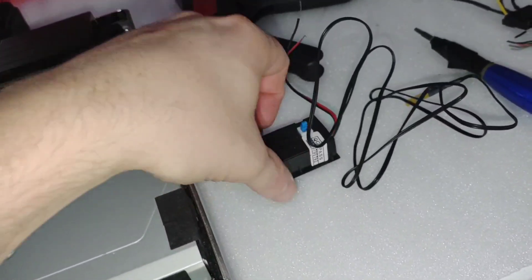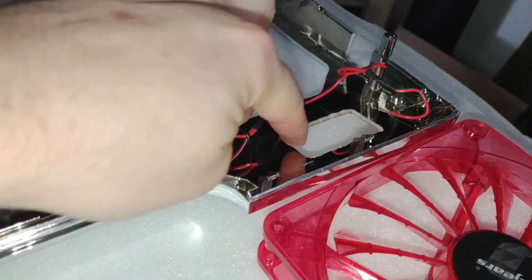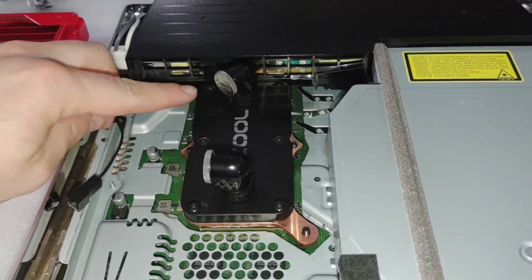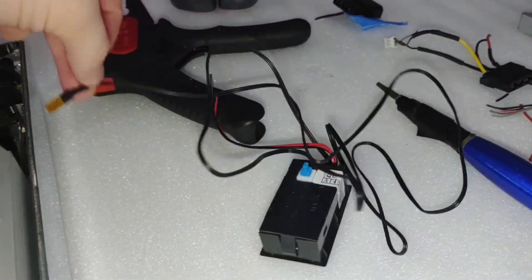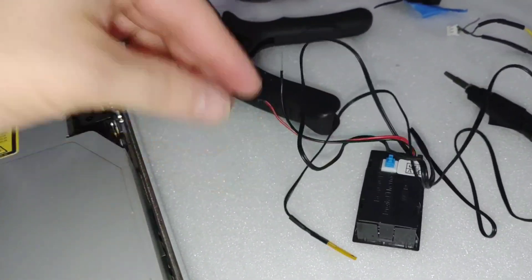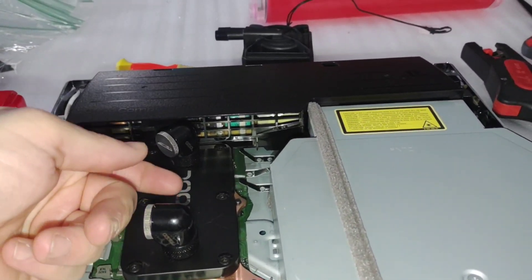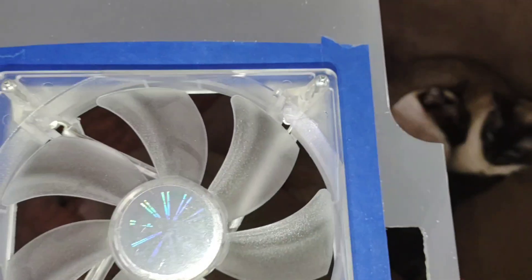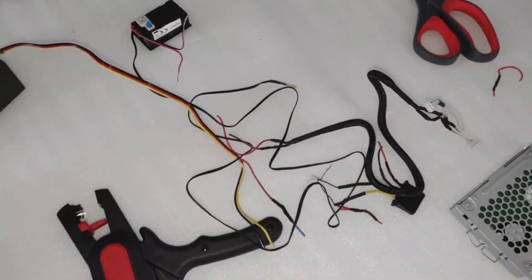This is actually the red one from the blood-splatter Xbox One, so it can switch between Fahrenheit and Celsius. I also need to slim down the little pegs on the side so it fits in the hole already cut from the last build. The temperature display from before was a plug fitting, but this one is hardwired. It has a flat sensor which I think will give a more accurate reading of the actual chip temperatures — we're going to feed that through the center of the water block so it's right between the two chips, touching the surface of the water block. Got the cutout enlarged and the holes drilled, and the temperature display sanded down.